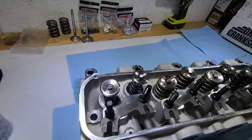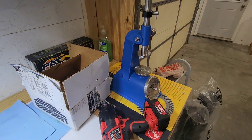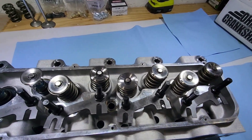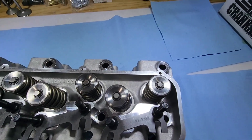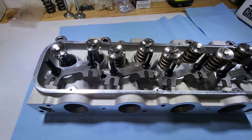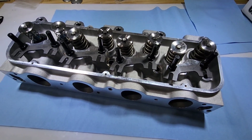I still have the checking springs in there and need to swap those out. The springs and retainers are PAC 1325 valve springs. I checked them on my valve spring tester — about 265 pounds closed pressure, 750 open, installed at 2-inch installed height, good for 800 lift. It's a solid roller cam. Titanium retainers — I believe they were VTO 3450 on the part number. With 70cc heads, a 6cc piston relief, and the piston two thousandths in the hole, it comes out right at 14:1 compression. I'm really happy with that.